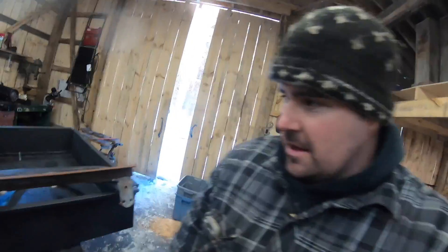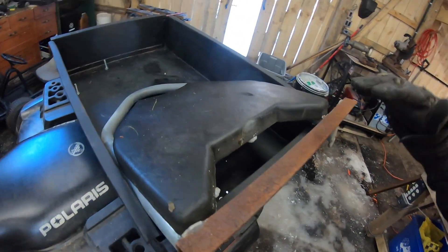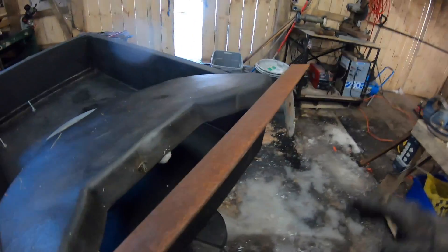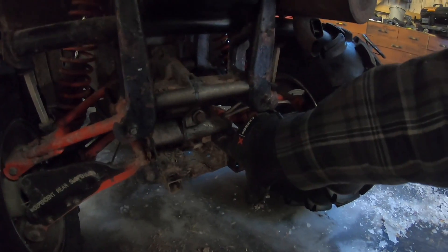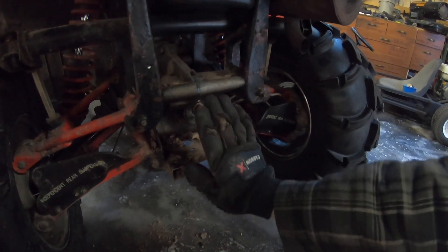So what I'm going to do is mount something down here. I think the plan is this. I went outside to the old scrap pile and found this thing — the old backrest off the go-kart. On the base here, someone at one point welded a piece of quarter inch angle iron. I'm going to use that. The angle iron is going to fit over top of these two steel members on the bottom of the ATV, which will allow me to bolt it down through two existing holes, and it'll provide rigidity so that the receiver can't tilt. This project, just like many of my other projects, is going to involve lots of scrap I have kicking around. Hopefully I can get this built for a grand total of $14.99 — the cost of the receiver tube. So let's get after it and see what we can do.